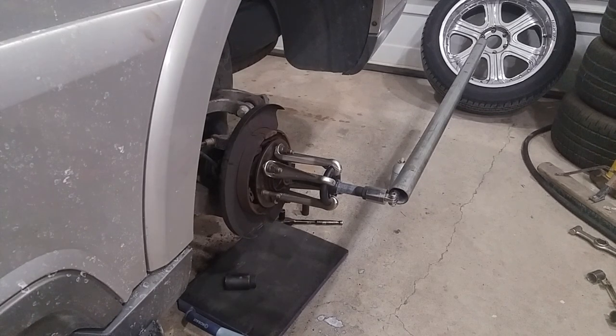Excuse me, I'm dying of a cold — sinuses are driving me nuts. I had such an issue finding the right tool to pull this hub off. This is a 2003 Lincoln Navigator rear hub that has to come off. It's a hub-bearing one unit that I ordered, but the axle would not punch out of the center of the hub. I searched online for suggestions, then gave up one day after pounding on it for three hours with a sledgehammer to the point where I was damaging the end of the axle.